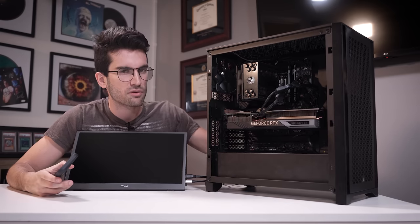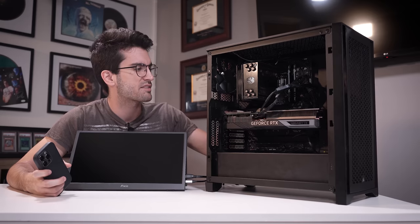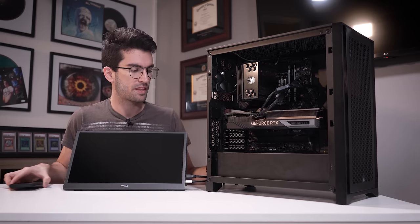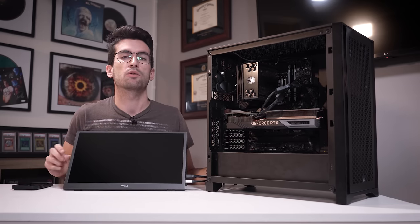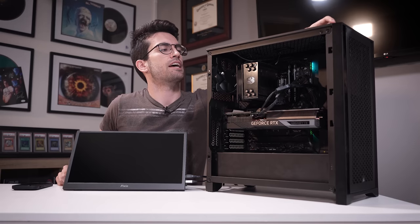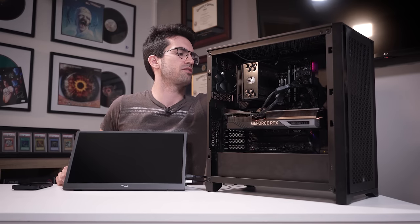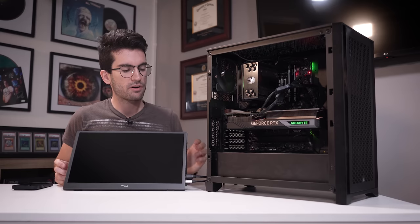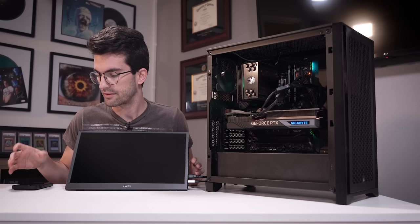I think it is a 13th gen CPU, and I think it's a B series motherboard. It's possible that we're dealing with a BIOS compatibility issue, and I don't think this motherboard has a Q-Flash or Q-Flash equivalent baked in. So let's try powering this on. We'll see if we can replicate the issue described, which again should just be a no post, probably a DRAM LED or something like that.